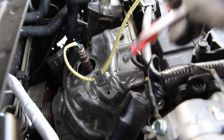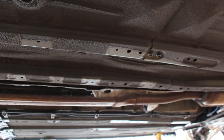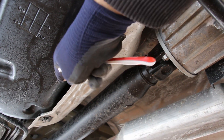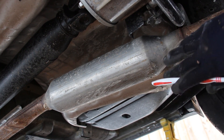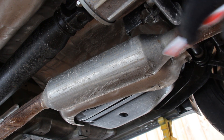Now at the back of the engine we don't have an exhaust manifold because it's integrated into the head. Instead there's just one port that comes out of the head and goes directly into this catalytic converter. That exhaust then comes through this flex pipe and into the secondary catalytic converter. It then continues into this unique flat-bottomed exhaust pipe and into the resonator back here. I'm actually quite surprised — for a Nissan, this heat shield material is actually pretty thick. We already have some scrapes on this rear resonator here and it is the lowest part of the vehicle, which is kind of a bad design. You really don't want your exhaust scraping on the ground — I'd rather have a suspension piece or something a bit stronger there.